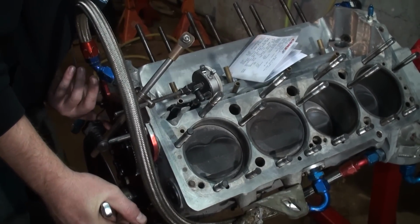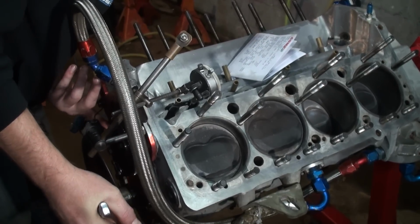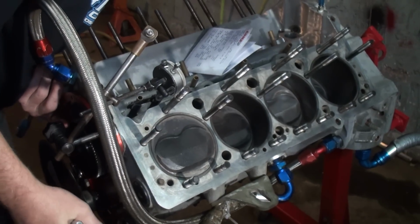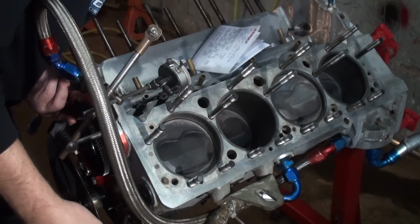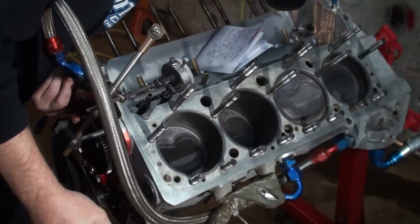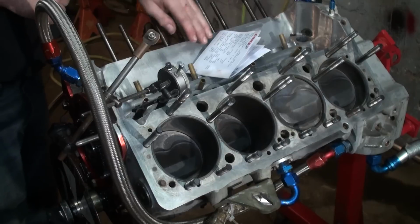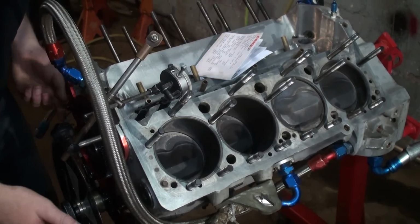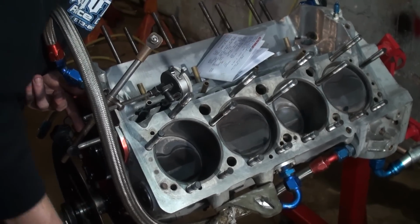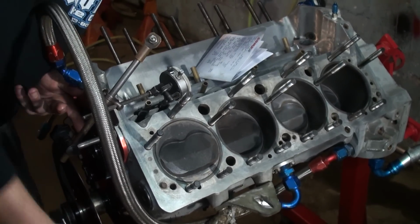So what we want to do first is look at our camshaft, and it's going to give us a measurement for our lobe. This specific lobe lift is 406 thousandths. So we'll follow it around just to make sure that they did everything the way it's written on the sheet. There's 1, 2, 3, and there's 403. So they're off by a little bit from what they wrote. So we'll make a correction that this lobe lift was 403 thousandths. You do want to keep track of everything that you can. And we'll bring it on back around. Watch the cam as it follows. And we are back at 0.